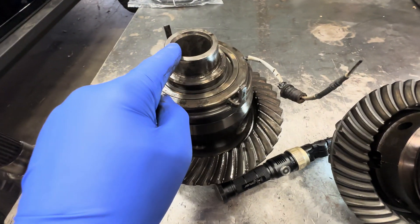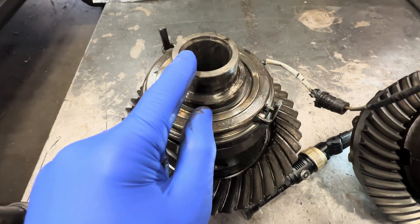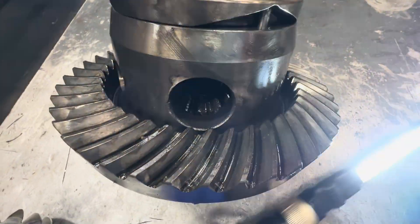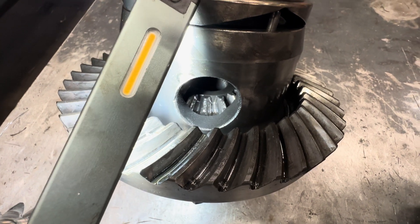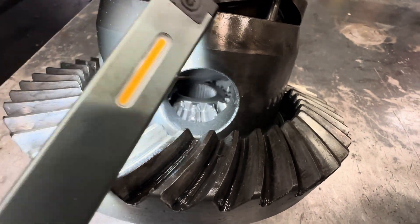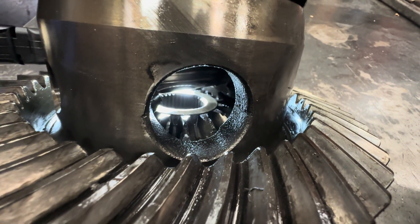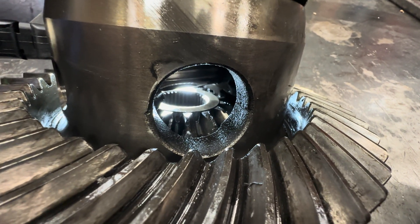I have no idea why they went to the two-pinion on a Dana 60. Weird. I don't feel it's that strong. This one's no good — the side gears are chewed up, they're done. You can kind of see right there, the teeth are gone. They are chewed up and done. And you can see there's only one set of spider gears. So it needs four of those little spider gears on that bigger side gear to make it stronger.